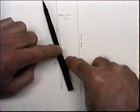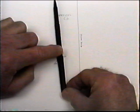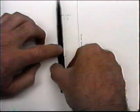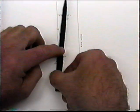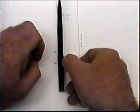For instance, in Joe Adamusco's case, he one time added a little lead sinker to the tip of the rudder to bring it back into vertical CG. Now, a plane will tolerate a certain amount of being out in the vertical CG. It can be out by 0.5 degree or whatever, but if it's radically out, then you really want to make that correction before you ever fly the plane.